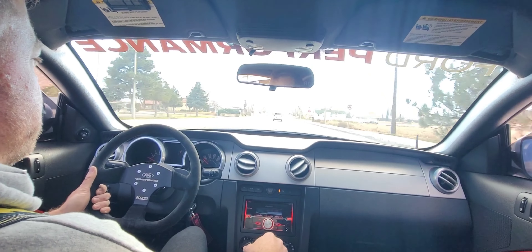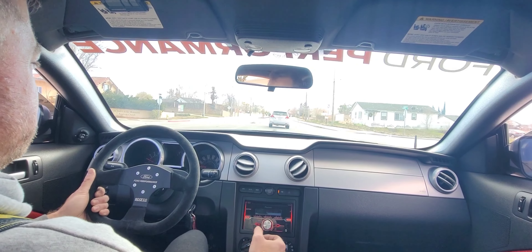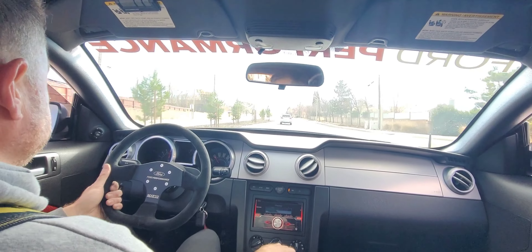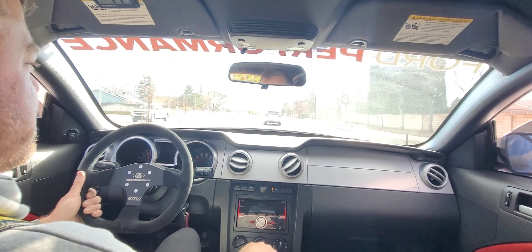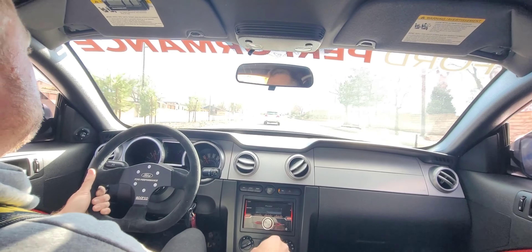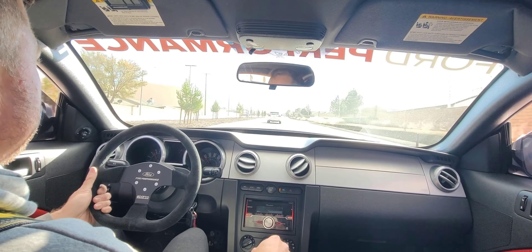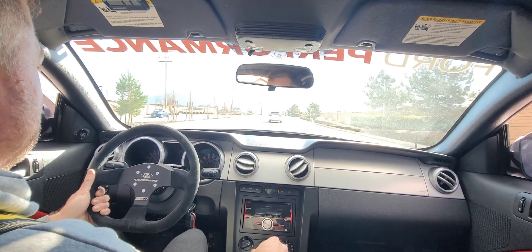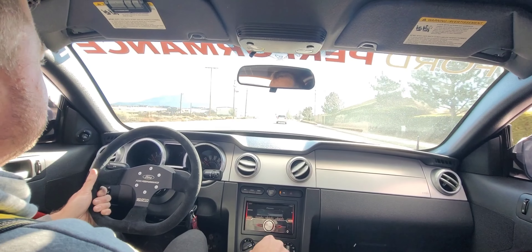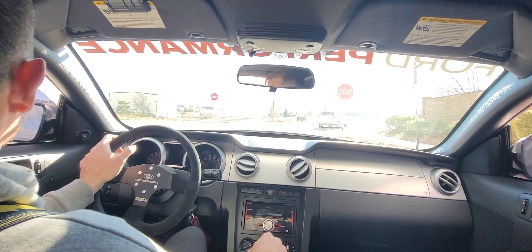I also had to unplug the battery to tack weld on this thing, so the computer's got to relearn — there's probably some timing changes, but it should be close. Wow, it's got a really different sound. Almost no drone at 2,500. There's some at about 2,200, which is at about 60-65 in fifth gear. So that's not too bad.